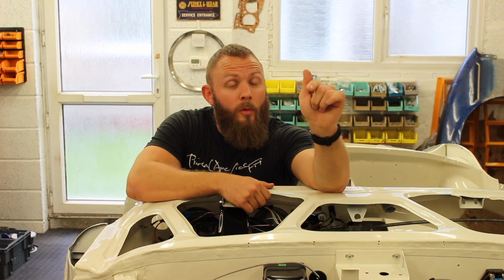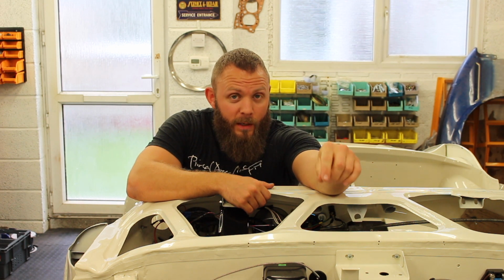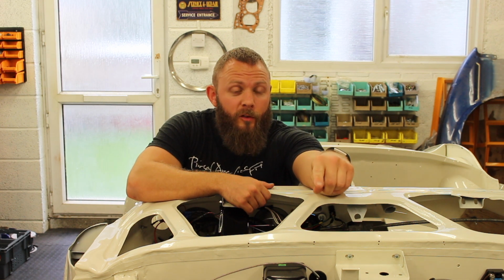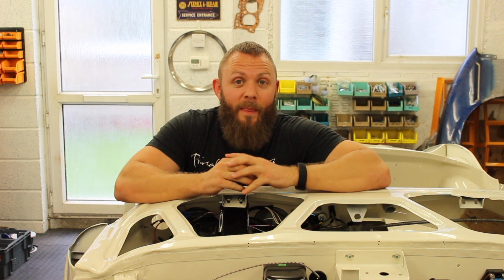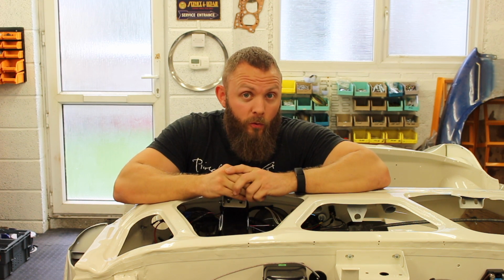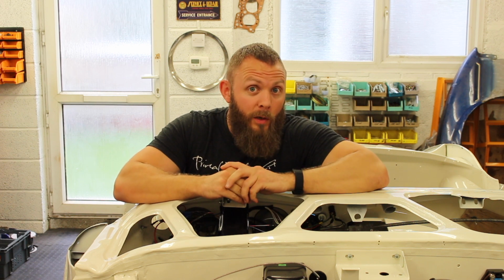Now on your 104, on the damper on the front of the crankshaft, you'll have a very small hole. That hole is top dead center. So we're at that stage now, we're on our mark, 6 degrees before top dead center, so now it's time to fit our distributor. Let's pull you around so you can have a little look.